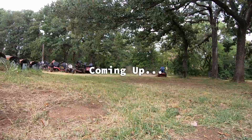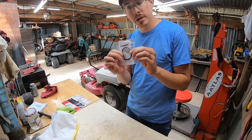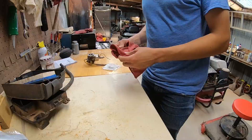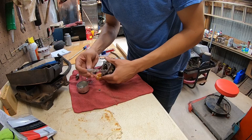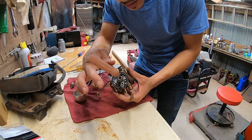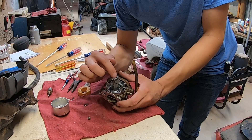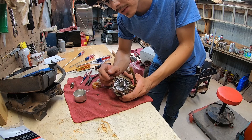Got our football gasket in, so let's clean the carburetor again and put this gasket in to see if it runs better. I took out the main jet and there's another jet right below it — two jets stacked on top of each other, and I have no idea why they would do that. It's a Kawasaki carburetor, not my specialty. I can see through it just fine and it's a pretty large orifice, so I think it's going to be okay.